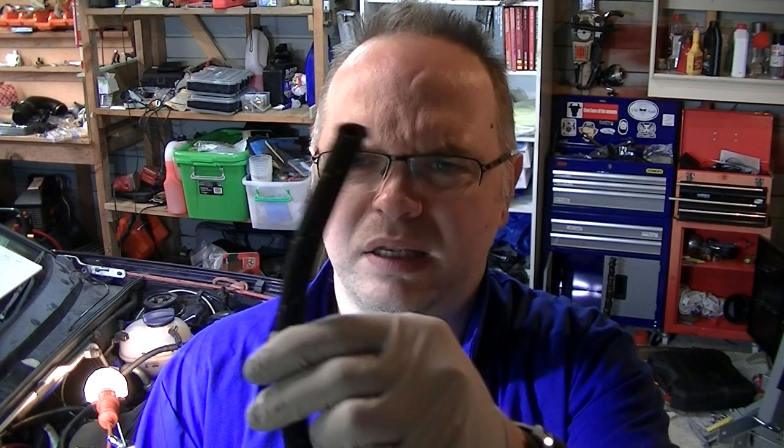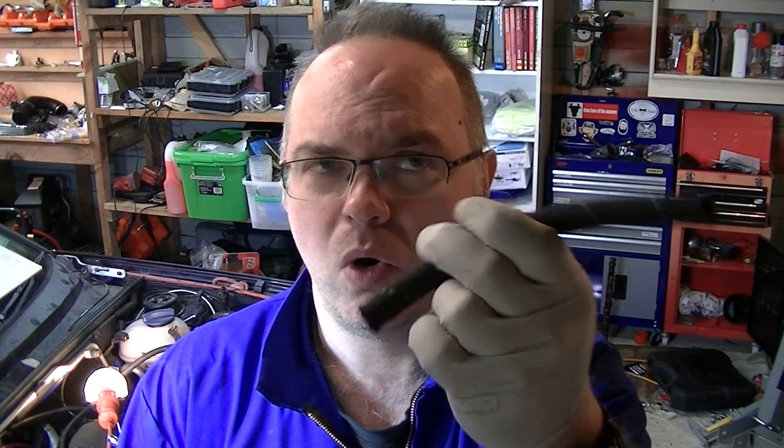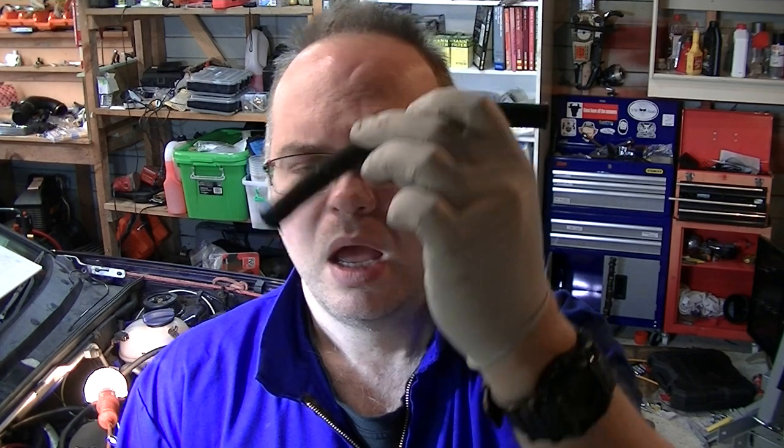There is a need to sort out the brake fluid supply. Here's the hose that came with my gearbox conversion — the auto to manual conversion — and this one seems about half an inch too short. So we've got some new 5/16 fuel line, which should be good enough for brake fluid, so we're going to chop a length for this.